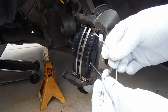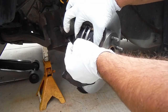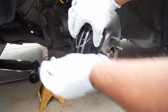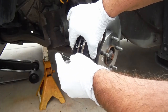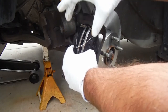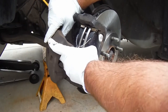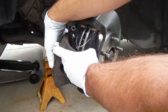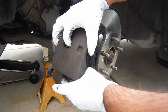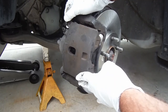A lot of brake dust built up underneath here — I'm wiping that out. Now we can put the V-springs in; you can see these little holes in the ends of the pads. You need one hand compressing the pads as you put those little springs into the ends — like that. The trick is to keep your hands on them because if you let go they'll spring right out. Then carefully get the caliper over the pads to hold the springs in place. Sometimes you have to pull on the slide pin a little to get it to line up.